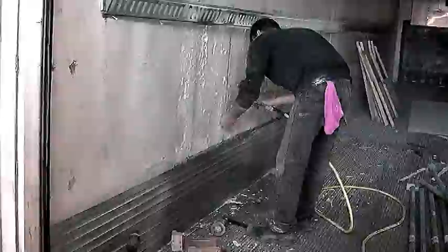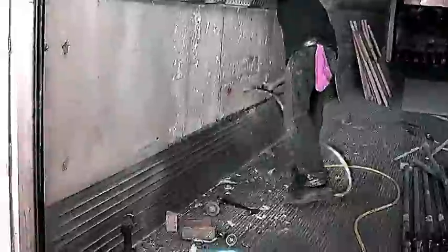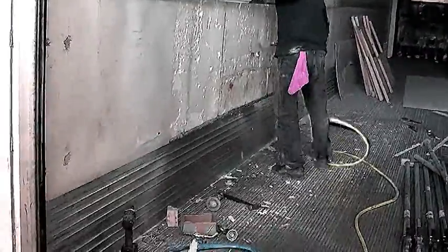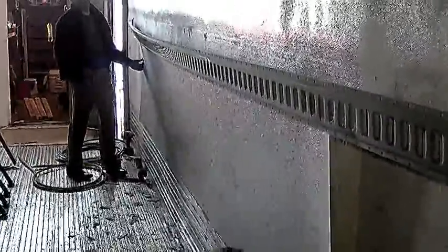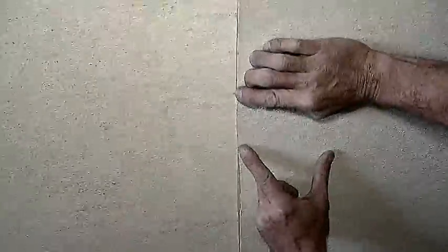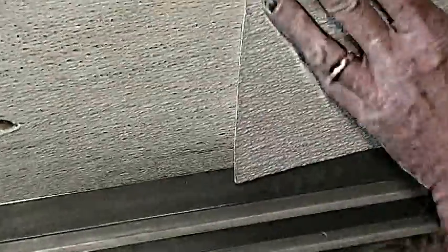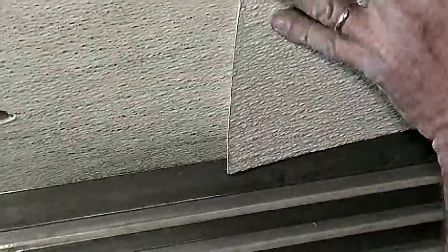Use an air hose to clean off any remaining dust or particles on the wall before you spray on the adhesive. At this point, place the panel in the scuff plate groove and line it up on both ends. You want the panel to be flush with the wall. You will have to trim anywhere you get an overlap. If you want to save a step, after you do the measuring step, you can cut the new panel width and cut the length a little long.